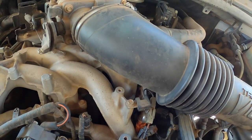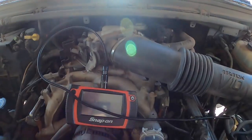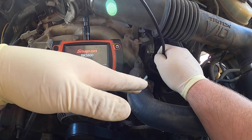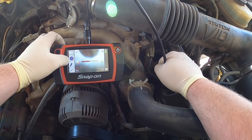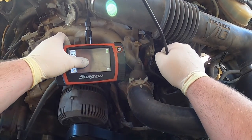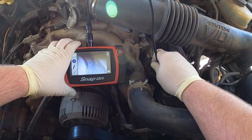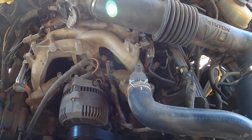The first step you want to do — I have a camera. I stick this down the cylinder. Let me see if I can get you guys a good shot. What I do is I make sure that the piston is down as far as possible, and I want to make sure that the valves are closed. You can see the piston pretty much all the way down. I'm going to put it in the angle camera side view, and then you can see both the valves right there. They're both flat, flush and closed, so we've got the green light to go ahead and start cutting it.